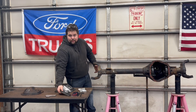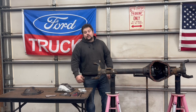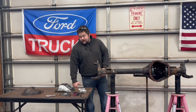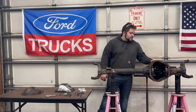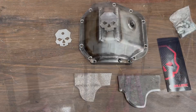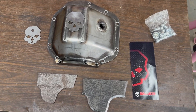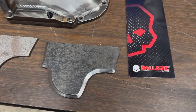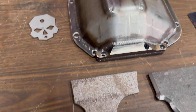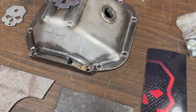What does that inch do for you? On this truck, that inch of clearance is the equivalent of going two inches bigger on tire — so that's something to keep in mind. The kit comes with a diff cover, two plates for the bottom — one seals up the diff and the other is a stronger piece of plate that you weld underneath for protection — plus a brochure and all the associated hardware.